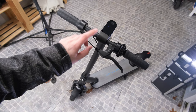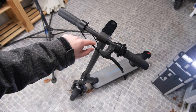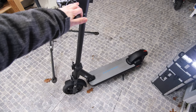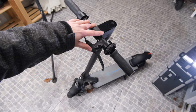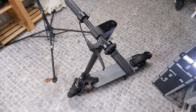The way the brakes work is it's a single cable-actuated drum brake in the front wheel, but the scooter detects that you're braking and also uses engine braking on the rear wheel. So you do get ABS on the rear wheel, and the front brake is very powerful but not so powerful that you'll go over the bars — or at least I have not been able to do that, and trust me I tried a bunch of times because I'm a bit irresponsible when it comes to that sort of stuff.